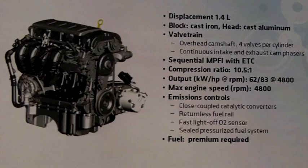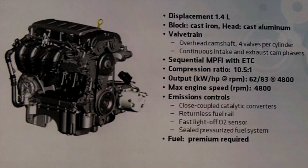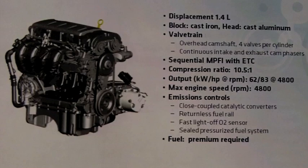One last thing: premium fuel is required. This engine operates and behaves very differently than in a conventionally powered vehicle. The RPM bandwidth is much smaller — when the engine runs, it runs at or near wide open throttle at a fairly low speed. With that, we can capitalize on the benefits of premium fuel and increase efficiency significantly — 5 to upwards of 10 percent by running premium fuel. You trade that off against about a 3 percent premium on fuel cost, so it's sort of a wash. We felt that was the right decision for this car.